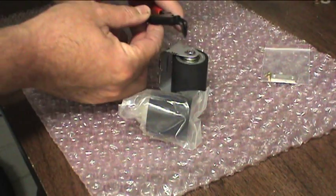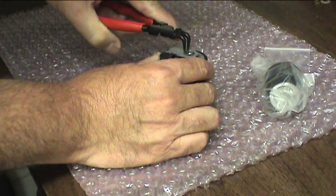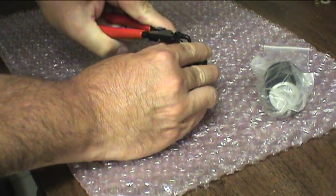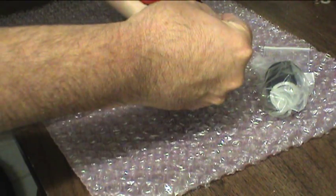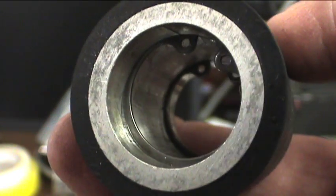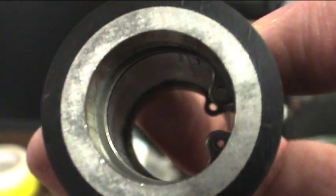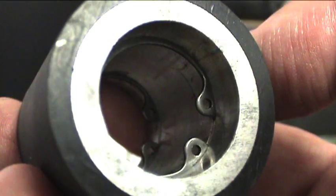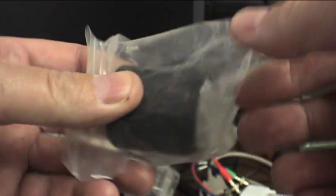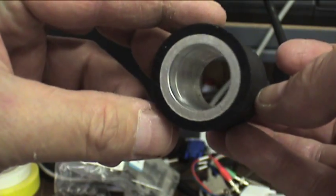Let's get to some mechanical parts. Here's the pinch roller — let me take off this clip. Of course that clip is 30 years old and it breaks when I take it off. But that's not a problem because fortunately I have a bag with several new clips. Here's the pinch roller with the bearings taken out, and you can see those clips that hold the bearings in place. This was the old one. I was lucky enough to have a brand new pinch roller that's never been used — it's even in a little bag.